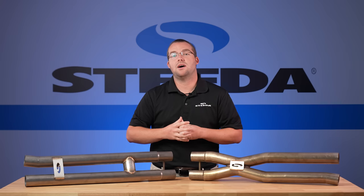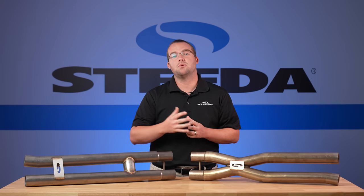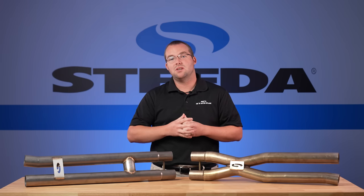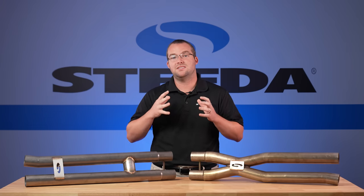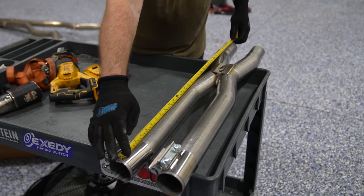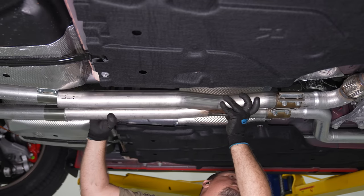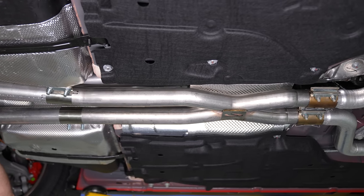A quick thing to note about all the dyno pulls in this video: the car had 93 octane in the tank, roughly 1,400 miles on the odometer, and all pulls were made in fifth gear. Another thing to keep in mind is that our dyno does read a little bit lower than some of the other dynos out there, but what we're really zeroing in on in this video is the differences between stock versus X and H. So after the stock runs, we let the car cool down and installed the X-pipe on this 24 GT. It's a cut and clamp installation, super easy, and 304 stainless steel, so you know it will last the test of time. Got that X-pipe up into place, some sound clips, and the dyno pull.